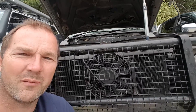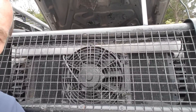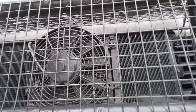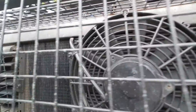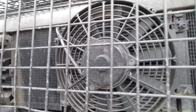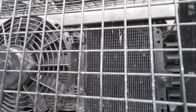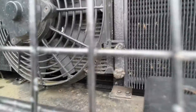We get some interesting overheating problems in here from time to time and here's a real ripper. Forget the steel mesh on the front — just have a look at where the actual radiator is, and we can't even see it. It's got a water-to-air intercooler on it and I'm guessing, I haven't even had a proper look at it yet, this is related to probably the cooling of that — it is completely blocking the radiator.